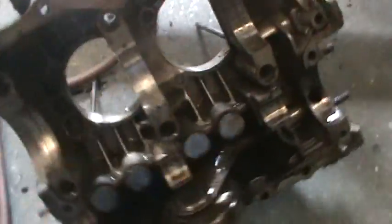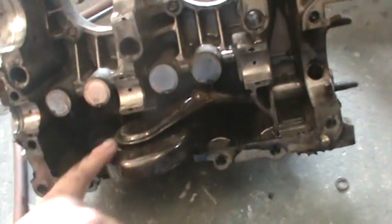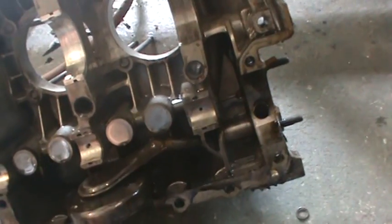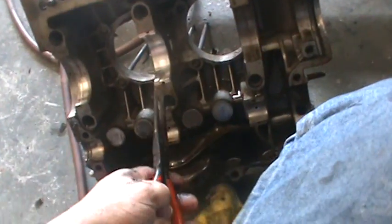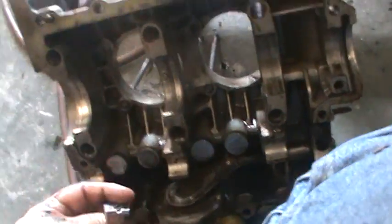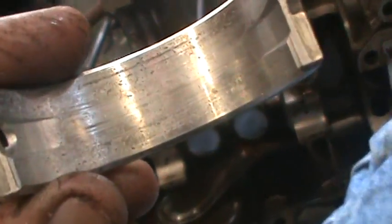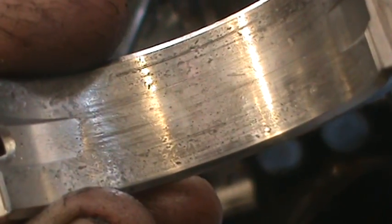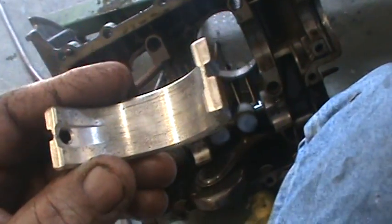Here's the other side. You can see we're into the copper on the cam bearing — same on this side too. The cam was very tight in there; you can see all the places it was binding. These are aluminum bearings, which I don't care for — and you can see why. The bearing is galled up. This is what happens with these bearings when they get hot: they don't have the integrity to hold up in any heat situation. The case feels decent, but this bearing has no substance to it at all, and it's a standard. The aluminum has a much lower melting temperature than the crankshaft, so if you lose any kind of oil film contact, you have bearing failure — and that's exactly what we've had here.